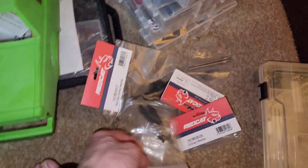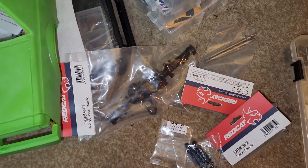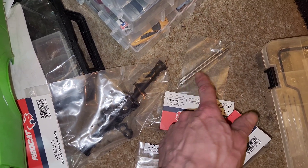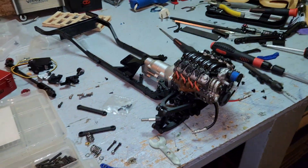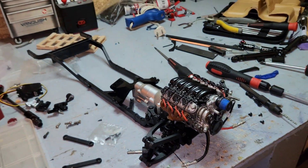I also got the axle shafts. I'm going to probably have to shorten the axle — cut these down, put these flats back on wherever I need, and that should work. I'm going to have to shorten the A-arms too — a little too wide for the Regal body. A lot of work.